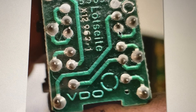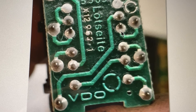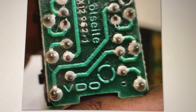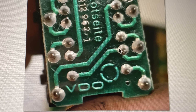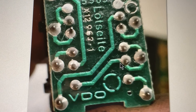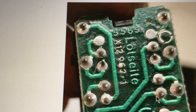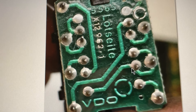Here you can see the coding plug. There's the big cutout and the little cutout — the plug itself is coated so you cannot see inside. You have a smaller area on one side, which prevents putting it in backwards. On the big cutout, you have the 3.3 kilohm resistor.